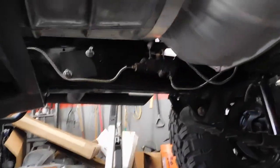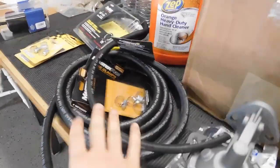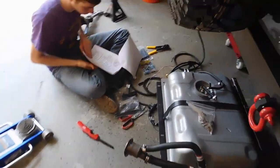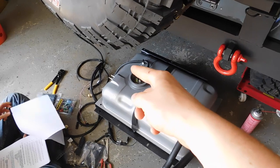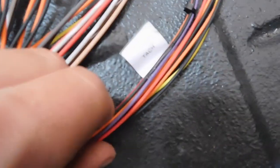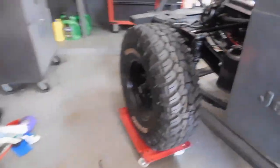Let the wiring begin. Alright guys, all the brake lines are in — in the front as well as the back, they're all new. Now I'll do the same thing with the fuel lines. New day — the objective is fuel lines. We got the pump here, I got some AutoZone random tubing and a decent fuel filter. We're going mechanical fuel pump just because it came with the engine, so why not use it. While I'm working on that, Jason's going ham on the Painless wiring harness so we can get the fuel gauge thing wired up. This harness is awesome — everything's labeled, like dash light labels, tach — it's plug and play, easy money. Our objective is just to try to get this thing running.